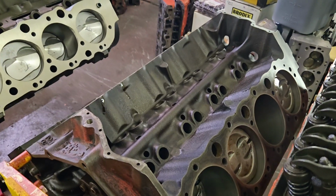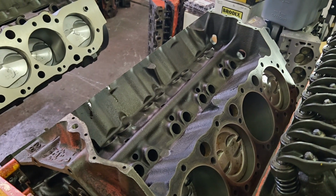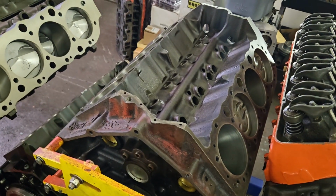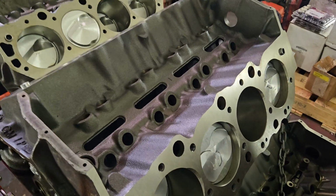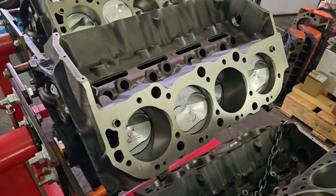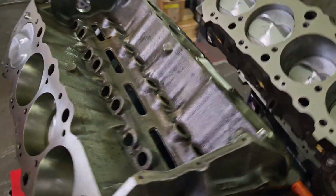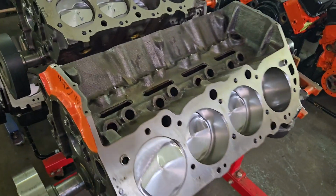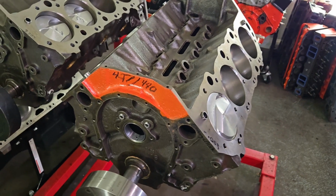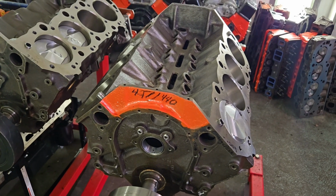That's my 350 that I just showed you a picture of, that's going to be in the $1,275 cheap engine challenge, each motor with a maximum budget of $1,275. That's a 350 Chevy standard bore. That is a standard bore 454 block, 10cc pistons. That's my 70 over 427. It's really a 454 block with a 396 crank, Keith Black pistons. I'm going to use this for the comparison against the Stroker 396.